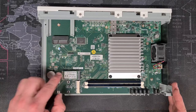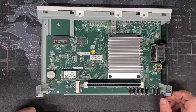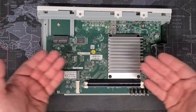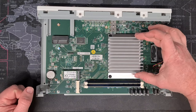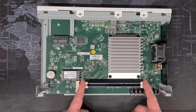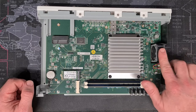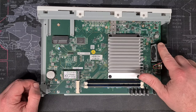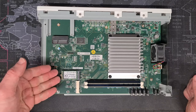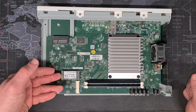The chances are that due to how Sophos flashes the firmware on the SSD on these, you may need to replace the SSD. You'll need to get an M.2 SATA drive. Inside you can see there's not a great deal: we've got a heatsink over the Intel Atom, a four and a two gig stick of RAM giving six gig total — the upper limit of XG Home Edition — a small fan, and the M.2 SSD which is what the system boots off of.